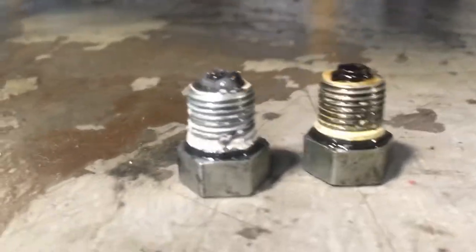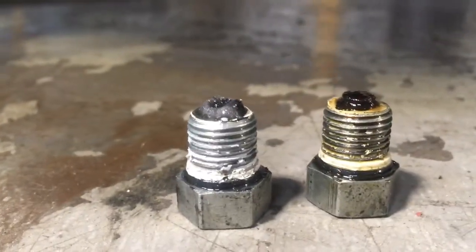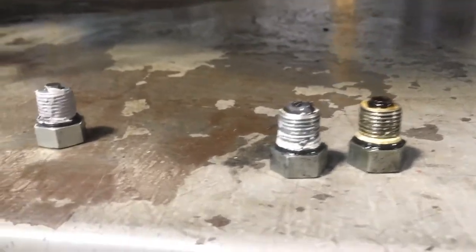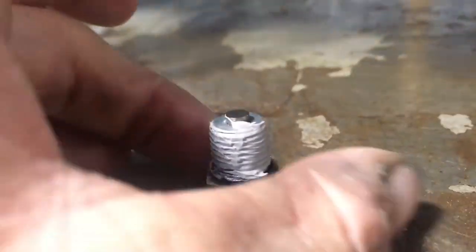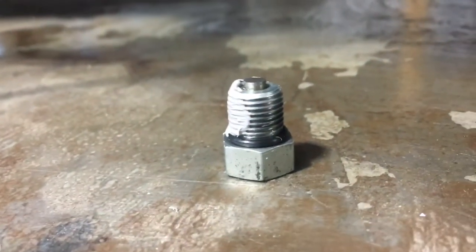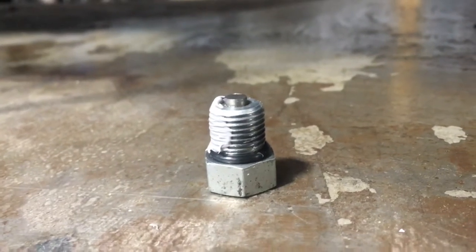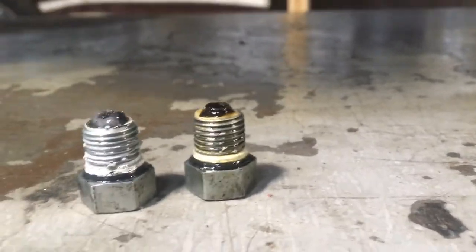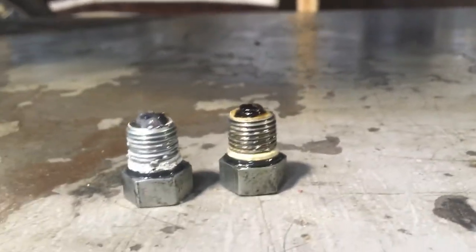The important thing is to also use this gray moto seal. I'm using Yamabond because that's what I've got — moto seal, ultra gray — it's all the same. When you're done it should look something like that, just a little smear on the threads. Give it a minute to set up a little bit, and when you run that in, that's oil safe. It's not going to break off in the motor, and unlike thread tape or pipe dope, you don't have to worry about it stripping out the threads and making it a pain in the ass.